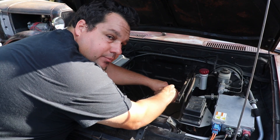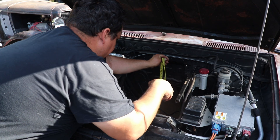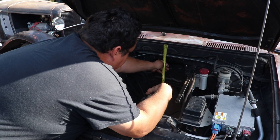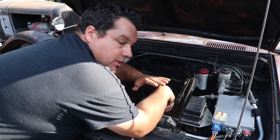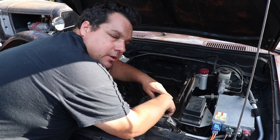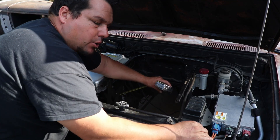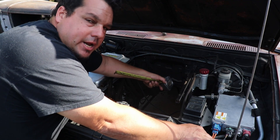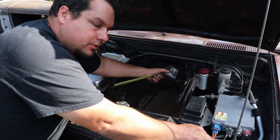I can move that radiator down — I think I'm going to have to at this point. I have a sway bar here and I'm way under over here, so this hood does slope down. That higher part is at the front, so I think I'm going to have to probably lower or relocate the radiator. That's completely fine. My main concern is getting the engine as low as I possibly can for center of gravity. If I can get the engine way down low, that'll help with CG.